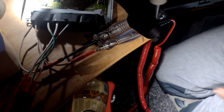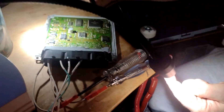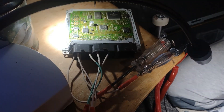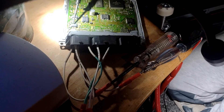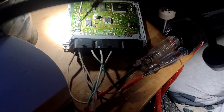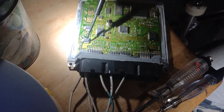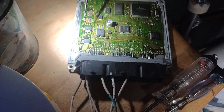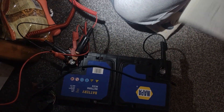One white wire goes into a test light - that's going to represent a coil - and the other white wire goes into another test light. These have two different coloured bulbs but that doesn't matter. The wire basically comes in here onto that base, and that's the same on the other side. It comes in through that and out through here - this is where it gets the ground. When this gets switched on, that gets a ground. These two go to the battery positive along with some other stuff, and then we've got the battery negative.